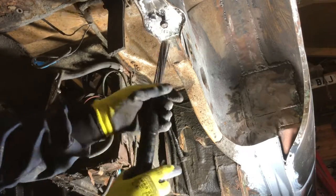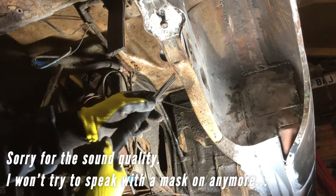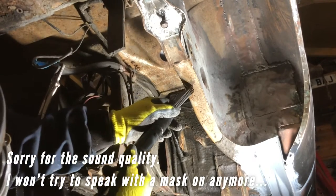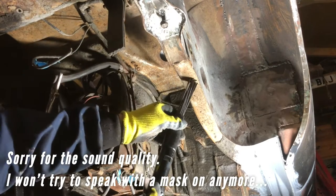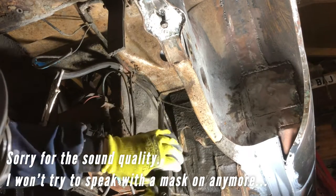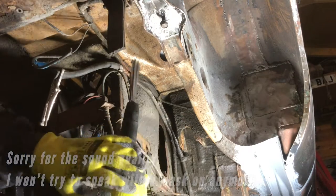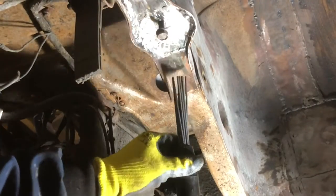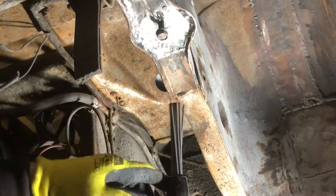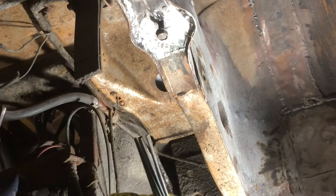These needle scalers, the more you become adept with them, it's not just a case of pushing with the edge of them or with the end of them, and it's not always a case of pressing really hard either, because if you get some bars which really are not looking like they're coming off, what I've found is that if you actually press, not lightly but not with massive force, sideways, and just let it drum away at it, eventually it makes it nice and loose.